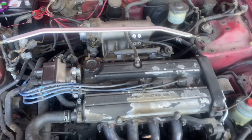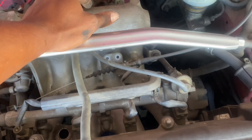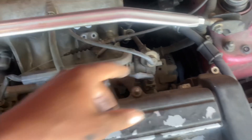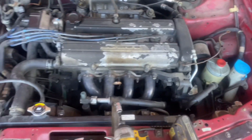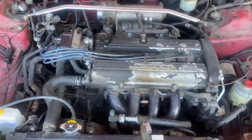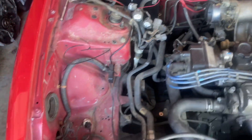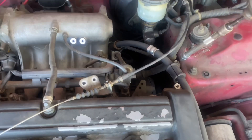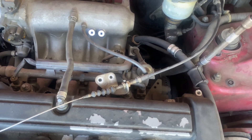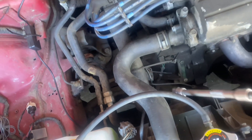We just have this 8 millimeter that we're going to take off right here and that'll disconnect pretty much the whole engine harness from the car. Next we're going to start taking off the brake booster line and disconnect the fuel system from the regulator right here — it'll be a lot easier — and disconnect it from the fuel filter. The strut bar is off now, just two 14s on each side, giving us access to the 10 millimeters for the slave master cylinder line.